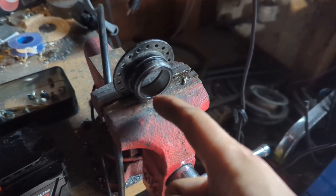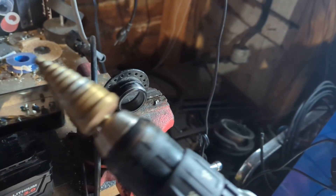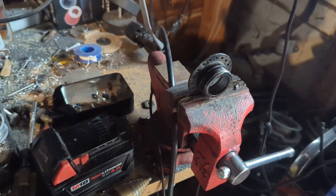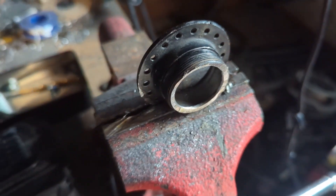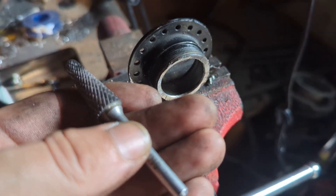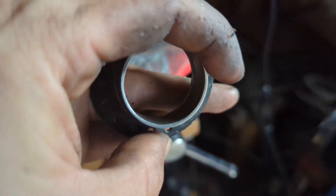Now we have to drill this out so that it's the same diameter as the inside, because it's got a big lip. Hopefully that drill is enough — if not, I really don't know what we're going to be doing. I would have thought that trying to grind away a bearing race would be so difficult, because it is. I'm going to try using carbide. Once it's hopefully all gone, there might be a little bit of lip left, but hopefully it presses on.